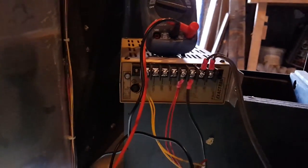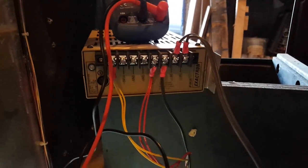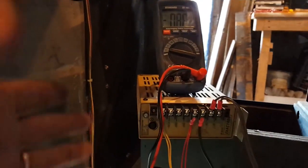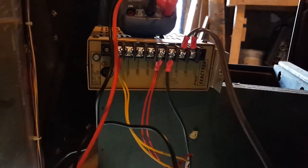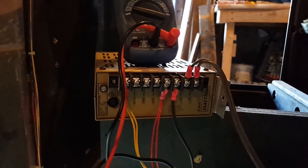What they've done is disconnected all the AC lines and used this switching power supply because it was converted to a Trojan afterwards. So instead of rewiring everything just for Pac-Man, I think we're going to stick with that format — it'll probably be more reliable, easier to fix and diagnose. And I can then use it as a JAMMA harness and put anything I want in this cab. If I want to put a 16-in-1 instead of just Pac-Man — for example, I have a Bomb Jack while I wait for a Pac-Man PCB, which I can't quite afford at the moment.